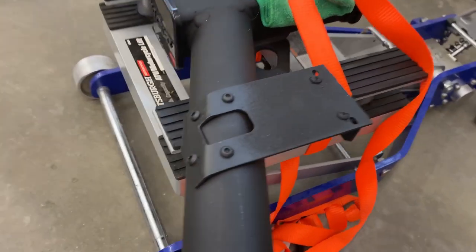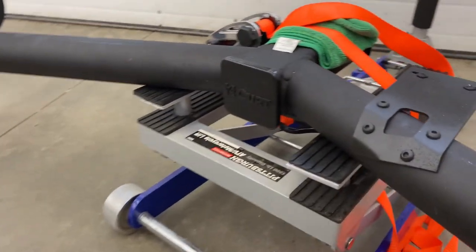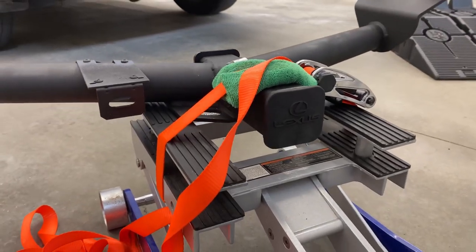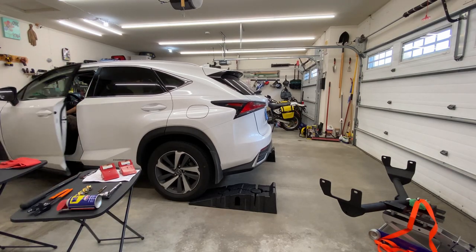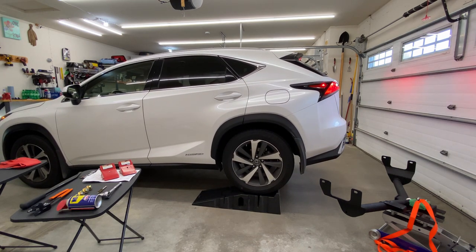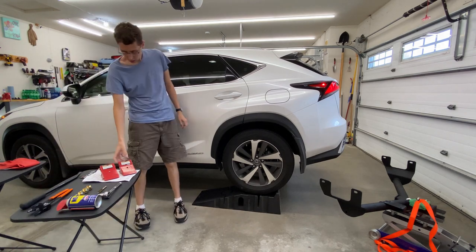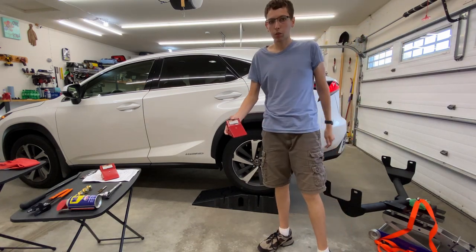I just took this, mounted it on here with a couple of six millimeter bolts, and I think that cleaned up really nice. Another quick pro tip is to put a receiver plug in the back of the hitch as well as the front, so that you don't have dirt and rocks being kicked up inside from the backside. So now let's get the car up on those ramps and get this thing put on. And don't forget, even when you're using ramps and you have the parking brake on, it's still a good idea to use some wheel chocks on the front, just in case.